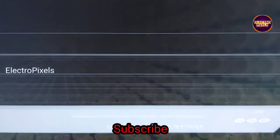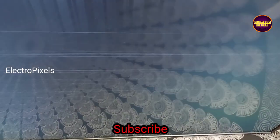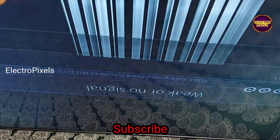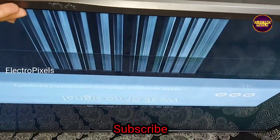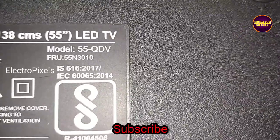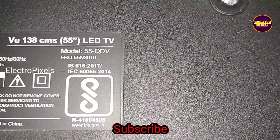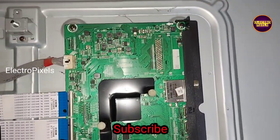These types of complaints are mainly due to internal shorting in gate signals inside the glass panel. It's a 55-inch 4K LED TV, so if both sides of the panel are shorted, it is not repairable — the shorting may be either from the left side or right side. The permanent solution is panel replacement; it is the one and only permanent solution.